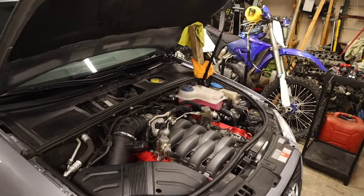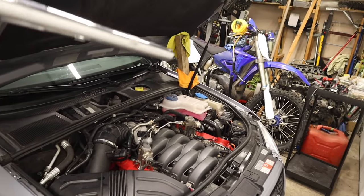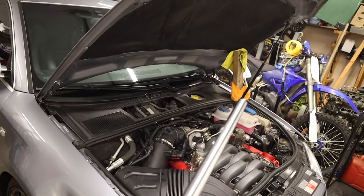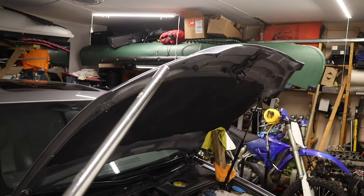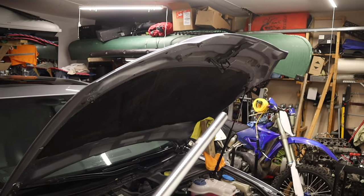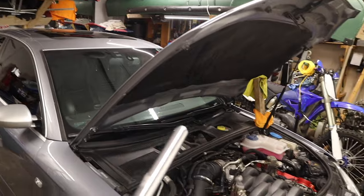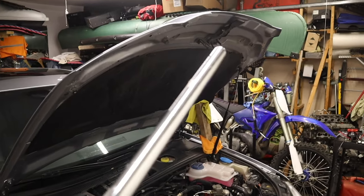Now that I've moved the frame — he talks about ordering a hood strut. In the overly nerdy RS4 community, there are people who say getting an A4 hood strut will actually flex the hood on this car because it's aluminum, whereas it's steel on the S4s and A4s. Personally, I've always been inclined to just get an A4 hood strut. I actually tried to get one from a car that was being parted out — that's where I got my trunk mat from, from a B7 A4 2.0T.